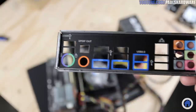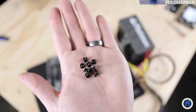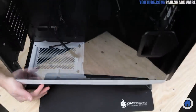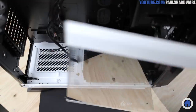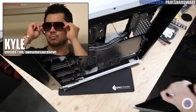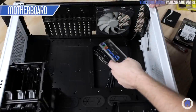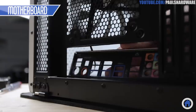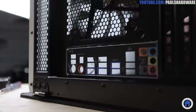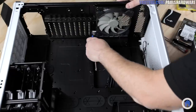I'm going to remove the CPU heatsink fan and clean the thermal paste from the CPU heat spreader to prepare for the Swiftech H220 installation. Clear off your work area, grab the input-output shield for your motherboard as well as nine screws that will work with your case standoffs. Bring the case on over, open up the side panels and lift them off, and set them aside somewhere safe. Lay the case on its side and pop in the input-output shield, labels out, and make sure that all four corners are seated.